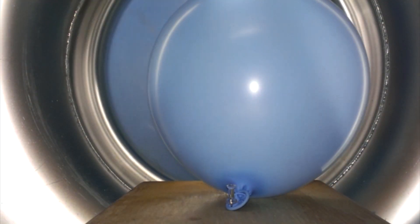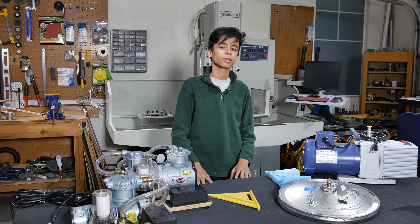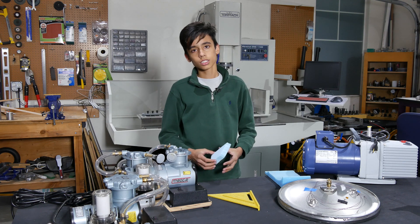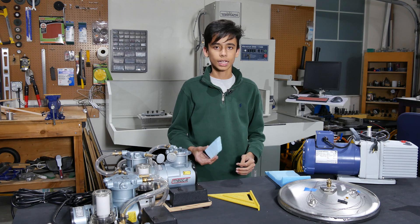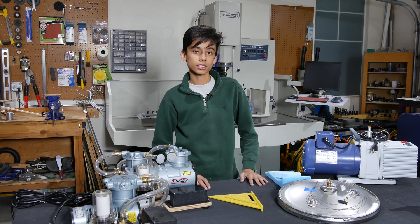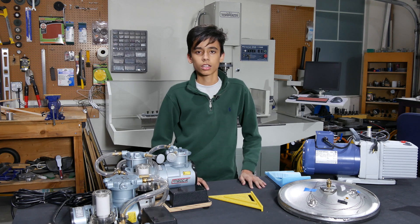The iPhone still worked fine, so we moved on to the next level. For the second test, we chose to film white and blue closed-celled foam, a marshmallow, and a kitchen sponge representing open-celled foam. The yellow square in the back is there to help you visualize changes in shape and size during the test. Closed-celled foam doesn't allow air or other gas to escape from its cells, so pressure changes affect the material directly. Open-celled foam also has cells, but these cells are interconnected, meaning air or liquid can move from one cell to another — a great example is a sponge.